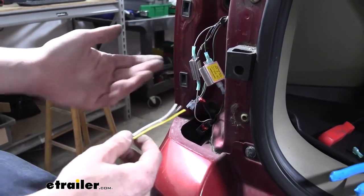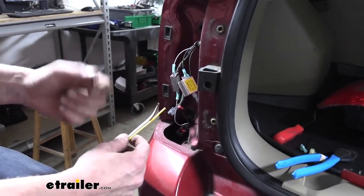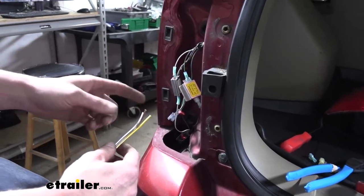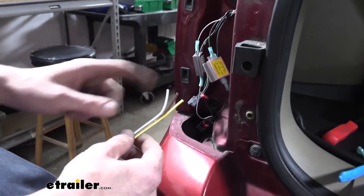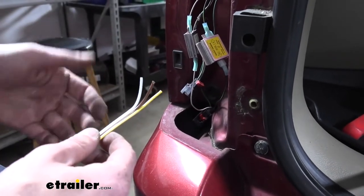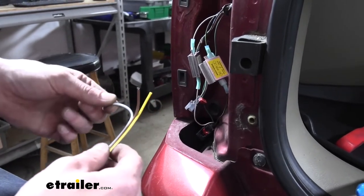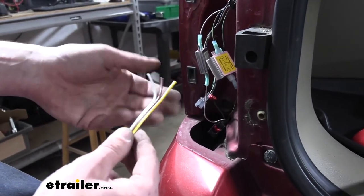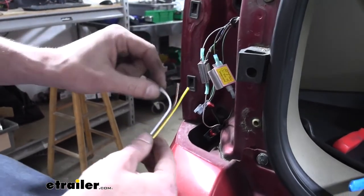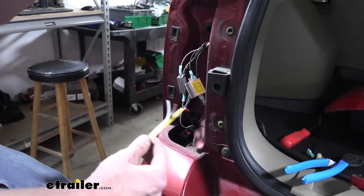The brown circuit here is for our tail lights — we need tail lights on both the driver and the passenger side. The white wire is our ground wire and we can put ground basically at any point on the frame on this vehicle. So we really don't need to have ground here at the back. We're going to use a small portion of the white wire in our loom to make a jumper to bring the brown wire's functionality over to the passenger side — it's going to be a white wire, but it's going to carry the same tail light signal.